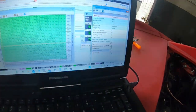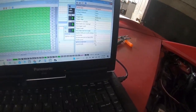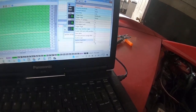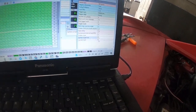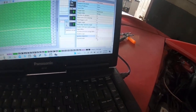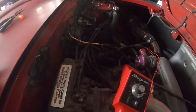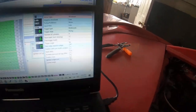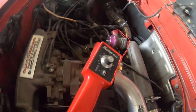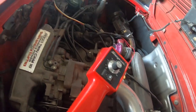We're going to go ahead and start the car up. Ideally you're going to want the car warmed up with a solid idle — it can be a little high as long as it's steady. Especially guys that have aftermarket cams, your idle is going to be lumpy, but if you can get it at a little higher RPM it'll usually mellow out enough for you to time it. Now there are two ways of doing this: you can adjust the trigger angle in the ECU Masters software, or alternatively if you have a distributor you can loosen it and literally move it left or right.